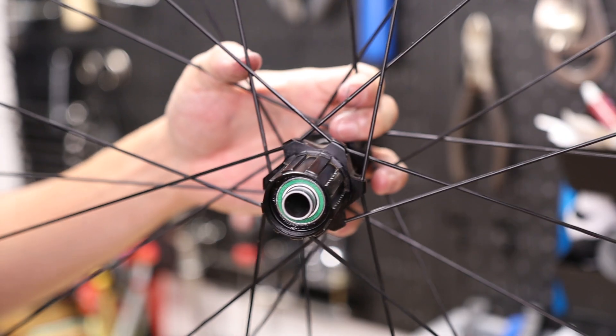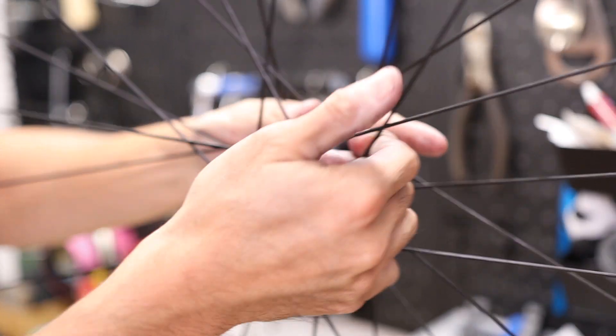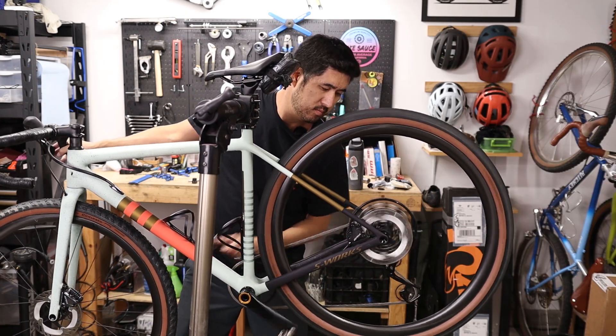Looking pretty good. The last thing to do is reinstall the hub end caps — these are directional: the shorter one is for the drive side and the longer one is for the non-drive side. Just press them on with a little effort. So there you have it — a full teardown and rebuild of a DT Swiss style star ratchet hub. DT Swiss's patent for this technology has recently expired, which is why we're seeing this design on a lot of wheels these days. There may be minor differences between a true DT Swiss hub and other hub designs, but in my experience they're all basically the same. All you have to do now is reinstall the cassette, put the wheel back on the bike and you're good to go. Replacing the bearings in the front wheel is even more straightforward because you don't have to deal with the free hub — it basically just follows the first half of this video. If you have any questions, leave them down below and I'll do my best to get back to as many as possible. Thanks for watching, and thanks for subscribing to the channel.